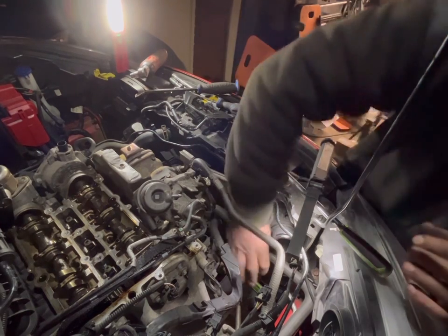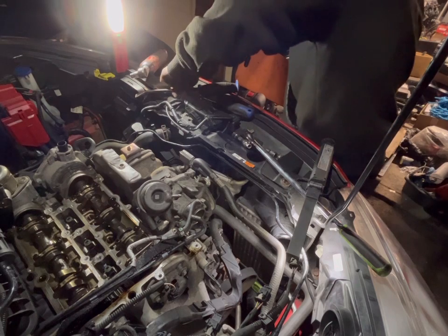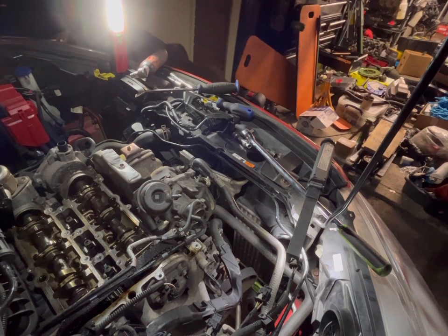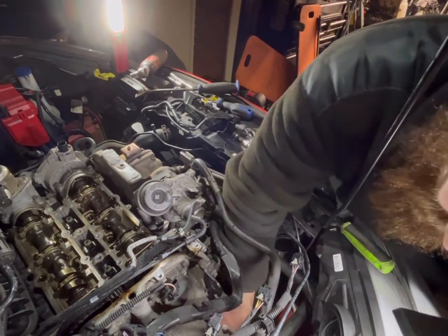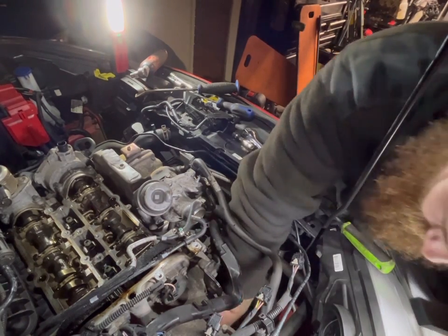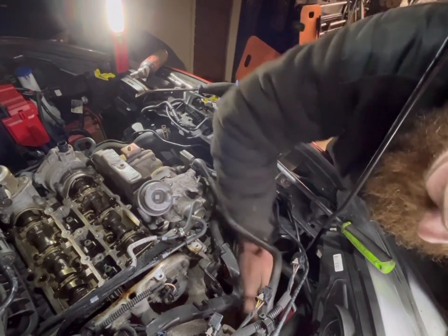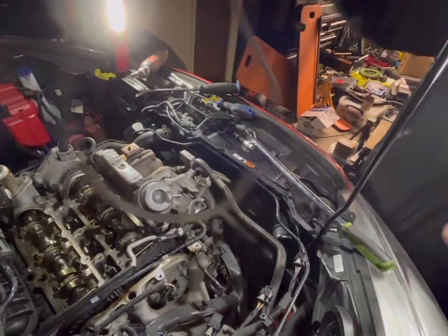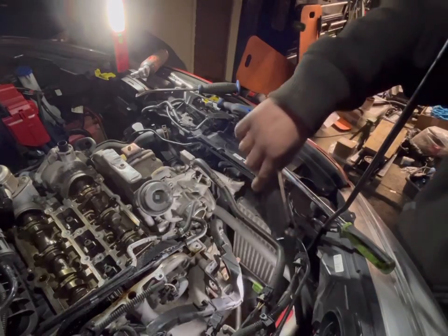That is that off — we'll need that off anyway. Water pump pulley — three 10mm bolts hold that on. So here we are — bob that down there, and now because of that you can actually get the poly-vee belt out. Just wiggle her off — poly-vee belt out. So that is that.